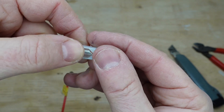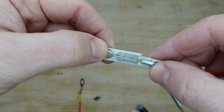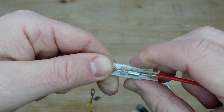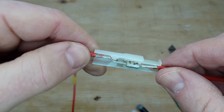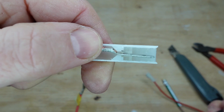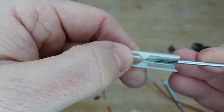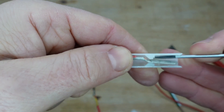You can see what happens when you put the two connectors together — they line up, go in, click, and are held together by the plastic housing. When taking them apart, for the male you push it forward slightly so it doesn't catch on the lug, then put your screwdriver in and push the lug down — now the terminal can be pulled out.